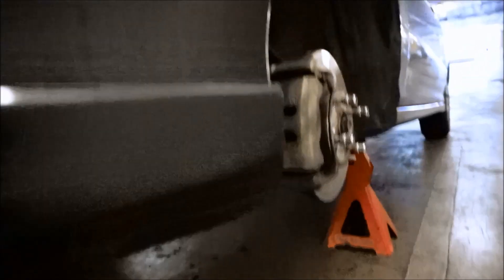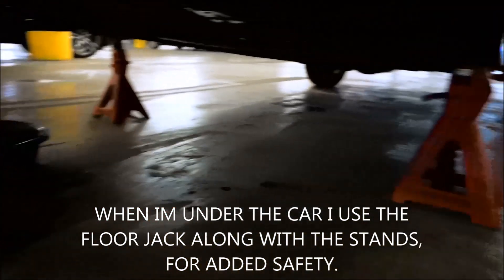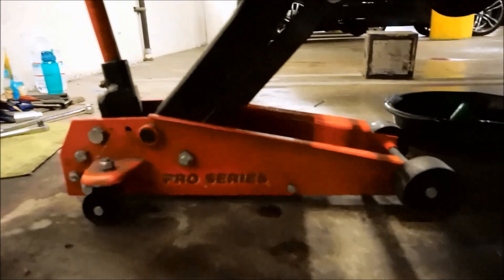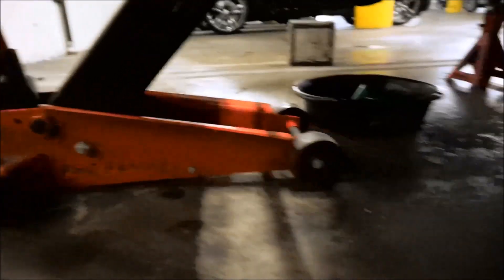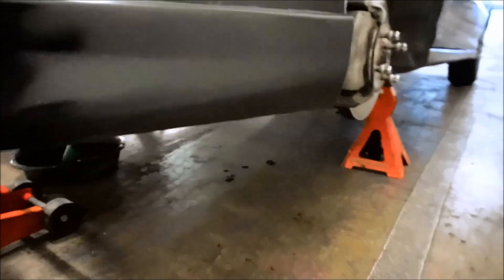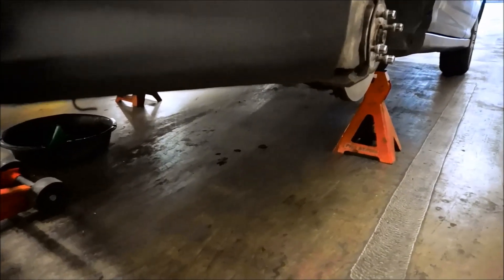I just took a quick break — got the wheels off, got it on jack stands, and got the axle nuts broken off. When I go under there to take off the rest of the bolts on the bottom, I'm going to keep the jack securing the car along with the jack stands. Whenever I'm under the car, I use the jack stand for added insurance, because you never know. I'm also going to use the jack to lower the transmission, but I won't be under the vehicle at that time. Now I've got to pull the axles off on both sides and get the half shaft.